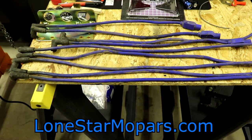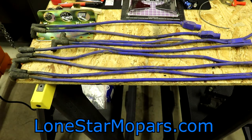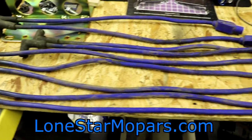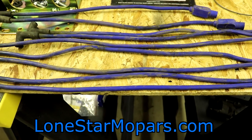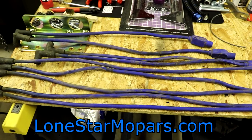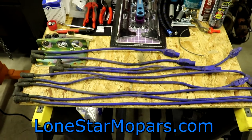Just like that — the magic of organization. At the bottom we've got the longest, which is the coil wire in this case. On Magnums, the coil is way up on the front accessory bracket. Then we go ascending one through eight. Going from the front side of the block all the way to the back, they get shorter. Not the cleanest things — this is your dramatic nasty before, so the video seems worth your time. Basically I use a blue shop rag, shoot my cleaner on it, and wipe it down.